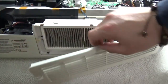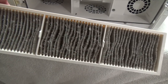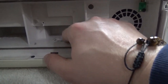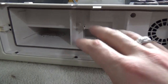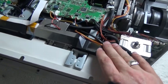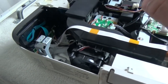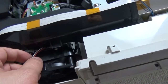We've got standard DC motors as suspected driving the entire lens mechanism - probably four or five of them. Moving around to the side, this is the air filter - and it's disgusting but it's there for a reason: to ensure these fans get nice clean air. We're not pumping potentially flammable debris, dust, or skin cells in here that could start a fire. There's some heat damage visible here too. This is loaded with fans - probably over ten total.